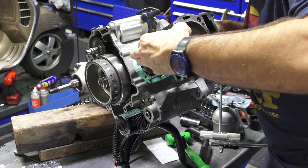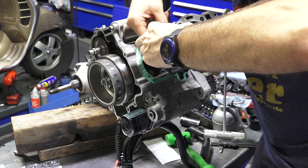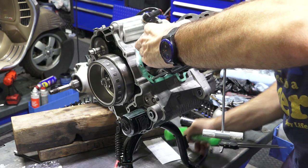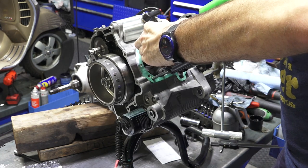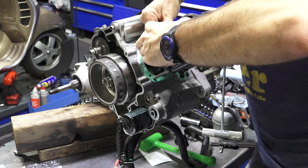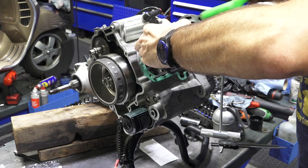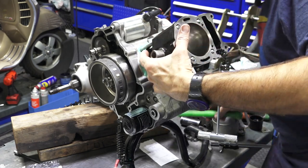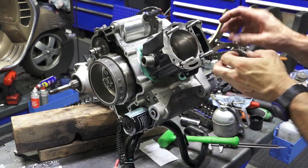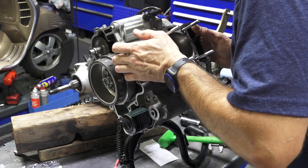And like I said, that's the most difficult ring. So I'm gonna kind of have to reshove it back in there. Of course, it's so much easier if you just get it all in one step. Give it a couple taps. Watching the gap close up on the oil control ring. There we go. Don't worry that the piston is no longer in top dead center. So you got your guide there, the two dowels are in place, and go ahead and just seat